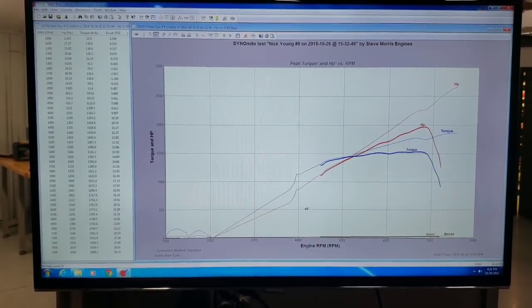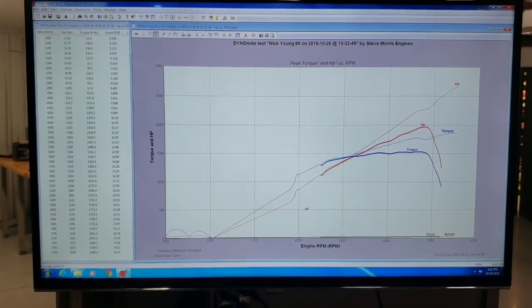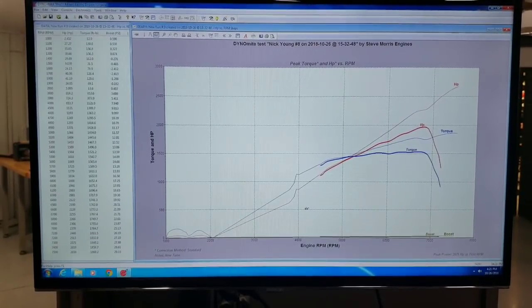I see you guys had all sorts of questions about the filter. With that big a filter, sometimes it will make it better on a dyno when it's sitting still. As far as going forward, versus having a funnel, obviously it's not as good as a funnel with frontal air, but that thing's actually really good. Sometimes it helps smooth out air, and I've not seen that big a filter ever do anything bad. If you've seen some of the stuff we did for our customer Grant Frazier, testing with the filters, like nothing.